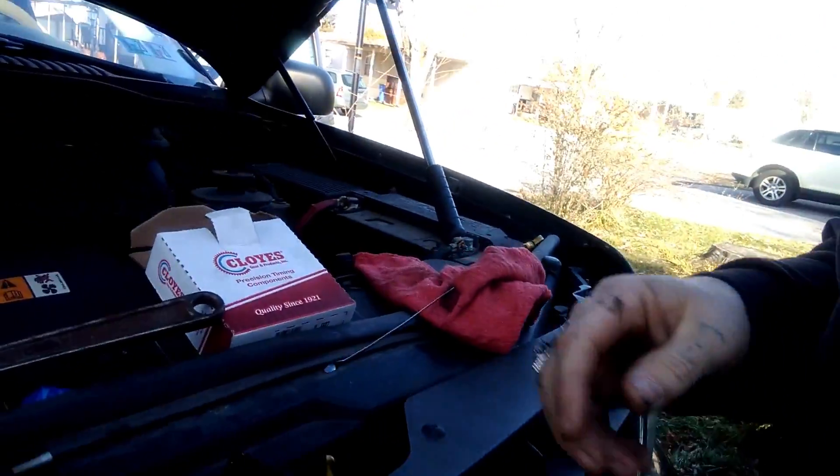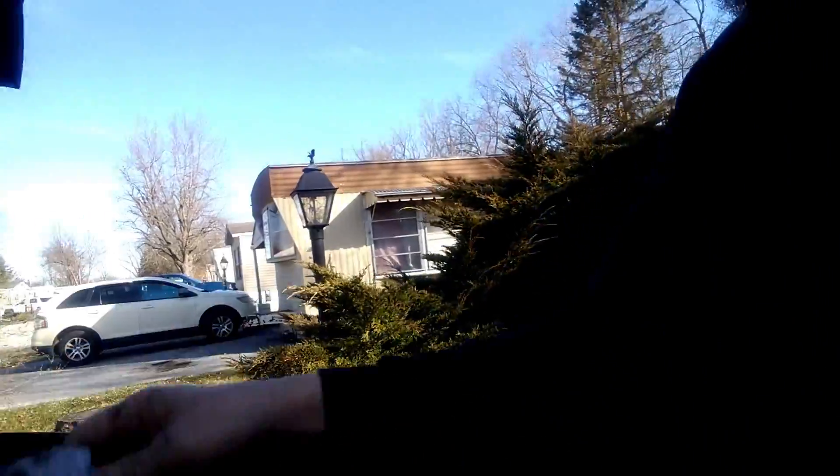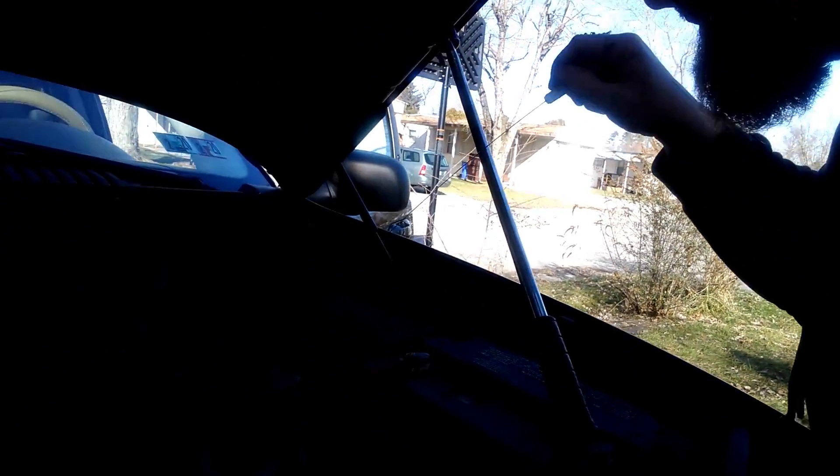Listen to see if there's a horrible chatter at first — there might be. Make sure all your stuff is off the engine bay area before you start so nothing falls in and tears anything up. I checked my oil level — good thing I came out here, my stick shows she's about a half quart low. I'm comfortable with it for my purposes, but make sure your oil level is good. Starting her up now — hear that, and then it quiets right down. Boom, just like that. Peace out, I hope I saved y'all some time and some headaches. Be sure to subscribe and like.